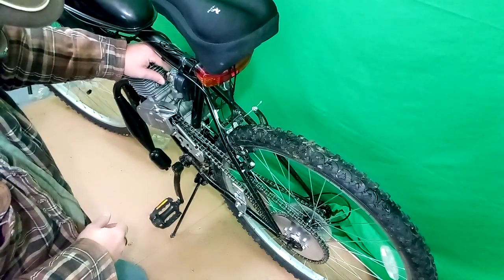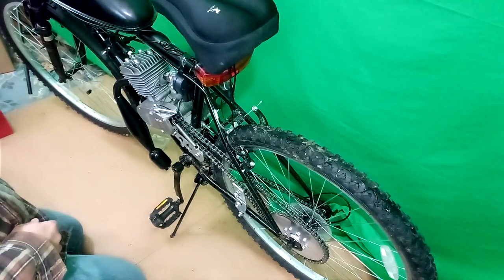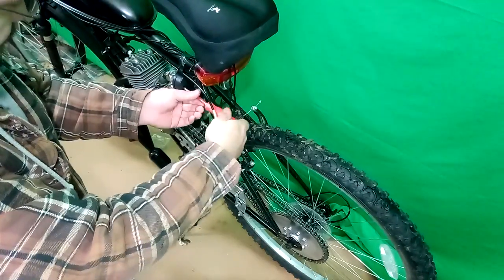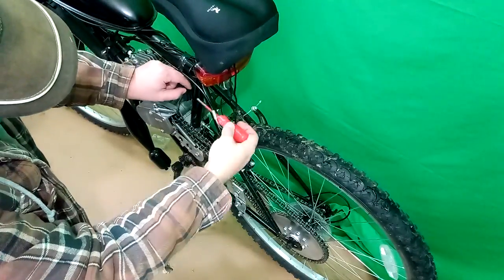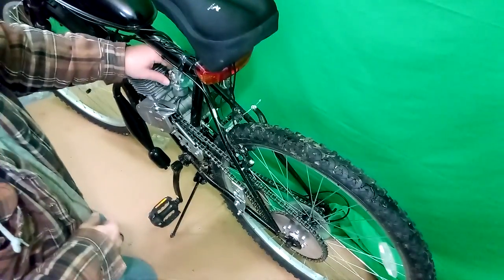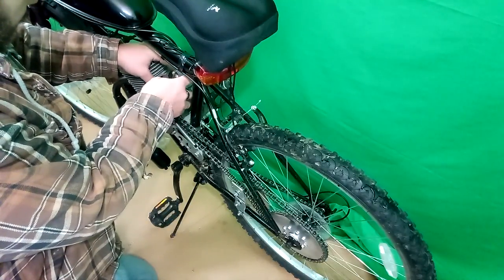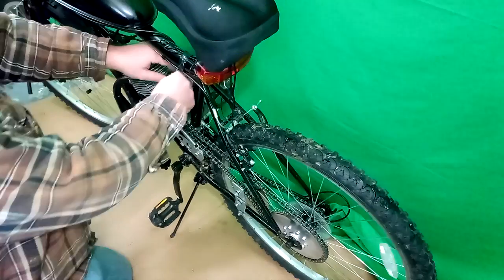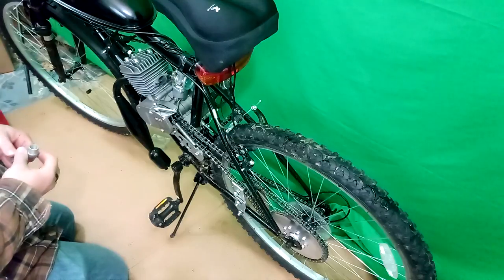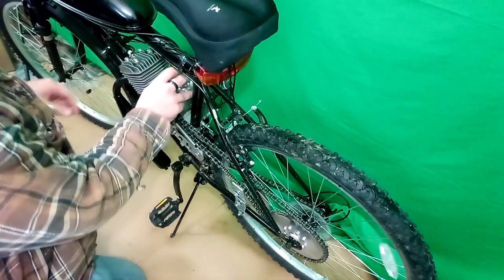So this is not going to move because of the carburetor. So I'm definitely going to have to — if I try to loosen the carburetor and pull it out, it might make it worse. So let's see if there's anything we can do. Now let's see if this will come out. Oh yeah, so now let's get our carburetor off. Now what we're going to do is take this and all the pieces that go with the mounting stuff here and put it all in one little bag so maybe we won't lose it.